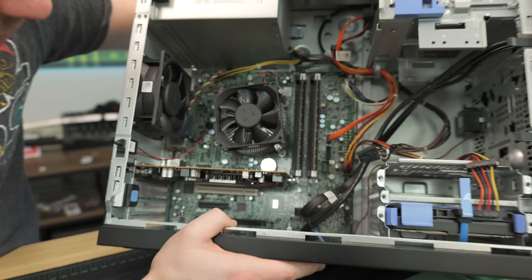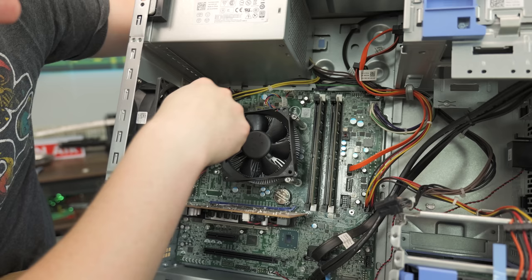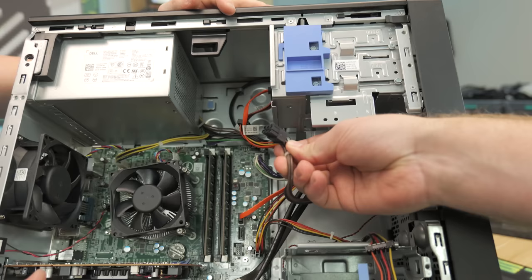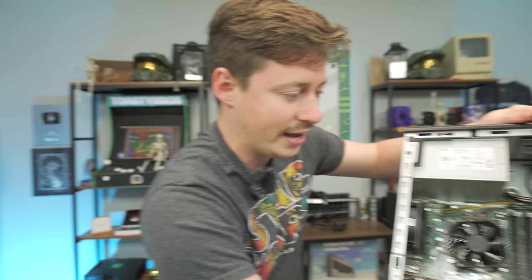On the inside it's a somewhat standard motherboard, except it's not fully standard — we don't have a standard 24-pin connector. Fan headers look normal, so in theory you could swap out the cooler. It does have PCI power — one six-pin. We might have to do some adapting if that doesn't work. But it is cool that it came with something, because a lot of office PCs won't have that at all.